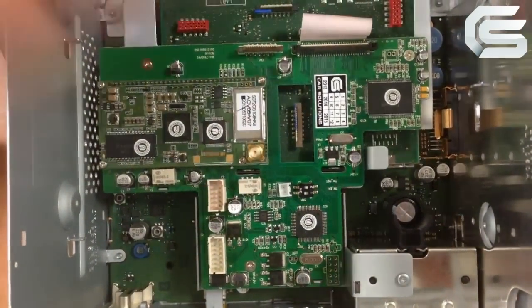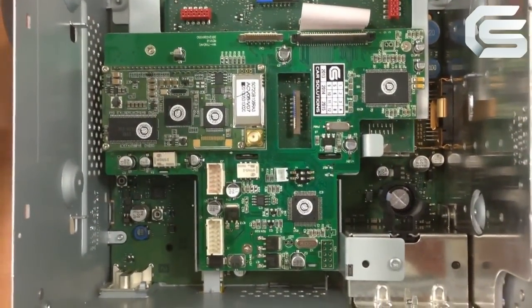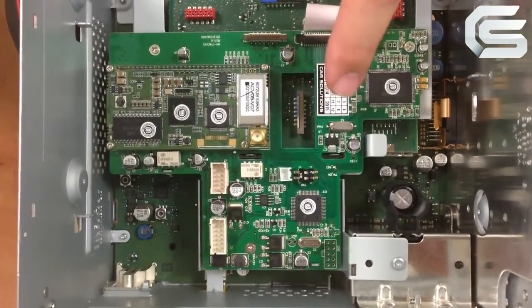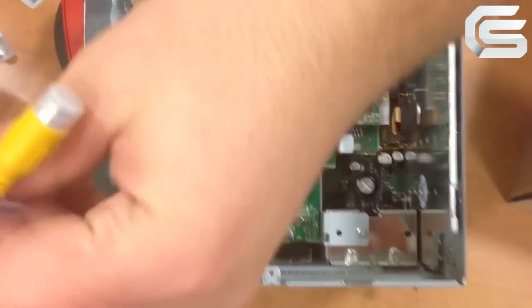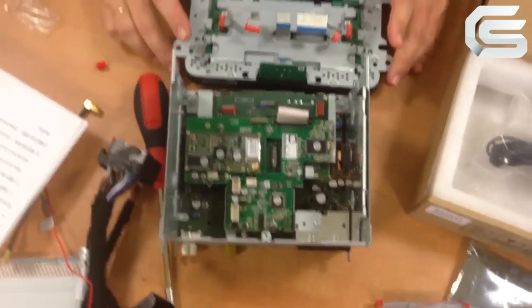The dip switch number 2 should also be in the on position, because we will connect the aftermarket rear view camera using the video interface. We'll use this one. I mean, we adjusted everything and can resume the connection.